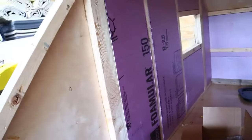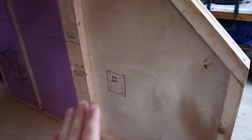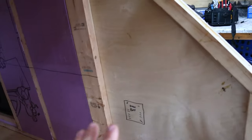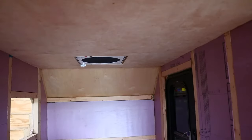I'm going to try to avoid putting any wiring on this wall — I want to do it all on one wall so my fuse box can be on this wall underneath the counter. It might not be mounted there but I'm taking my wires there, so once I get my countertop in I can decide where to put the fuse box. So we're just going to get the rough-in wiring going.